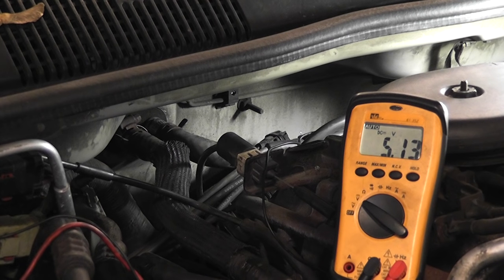What I want to show today is how to do a crank sensor test on a Chrysler product. This is a 97 Jeep Grand Cherokee. All of these Chrysler systems use Hall Effects for their crank sensors — that's a three-wire sensor that makes a digital square wave. On this particular design, the power feed is the five-volt reference circuit, which is also the feed for all the other sensors. So this is a shared reference, shared power feed for this crank sensor.